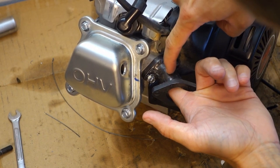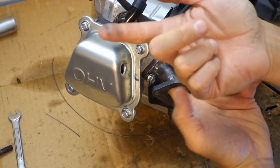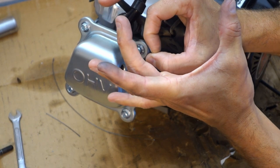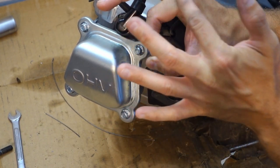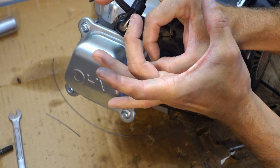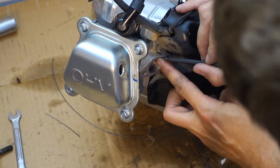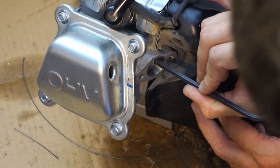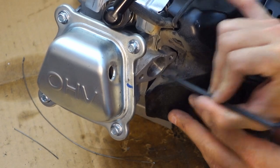I want to reach inside and check where the inside of our manifold meets the intake of the head — I'm looking for our manifold to be a larger opening than the head. If the head size is smaller than your manifold size, you've created a wall, and we want the smoothest possible airflow into that surface. I've taken our grinding bit and trimmed up here a little bit because the air was crashing into that lip, so I just need to focus on smoothing that area down.